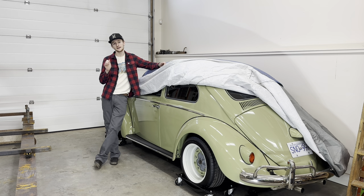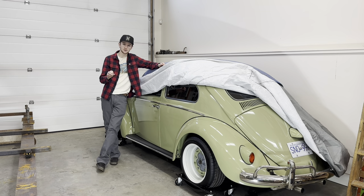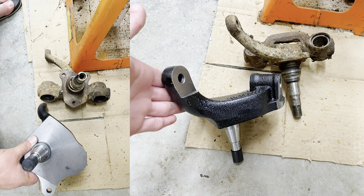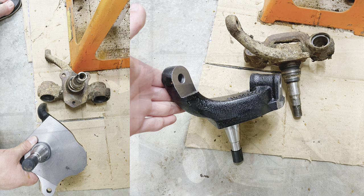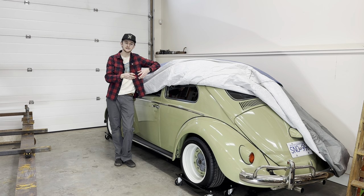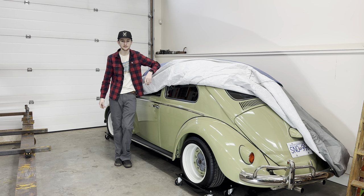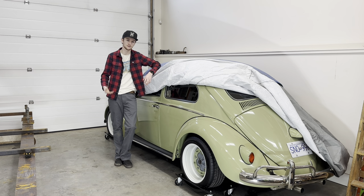In the front there isn't necessarily an easy way like the rear. The easiest way I'd suggest is buying two-inch dropped spindles from a place like California Imports — they're sold in a lot of places. All you have to do is knock the kingpin out, put in your new steering spindle, then put in your new kingpin. Sometimes with old cars it's worth replacing those anyway, and you'll have two inches lower in the front, which is sometimes enough, especially if you're going to a lower profile tire, which also lowers the car.